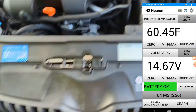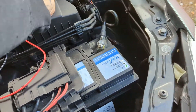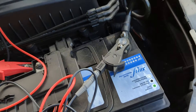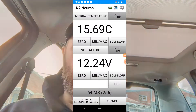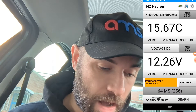Let's move on to a battery that is brand new — brand new two months ago. Here we are at the Skoda. Let's hook this up to this battery. We'll load the app up again and sit in the driver's seat. I don't know if this battery is a bit low as well — it's only 12.2. I'm going to click on the battery systems test, battery state of charge. Recharge before testing. In fairness, this car has been sat for two weeks without being used, so that may have an effect.